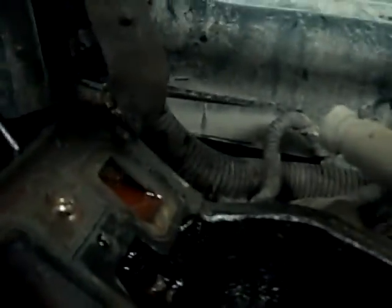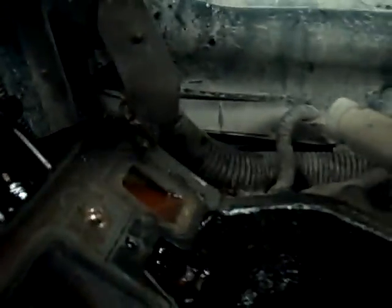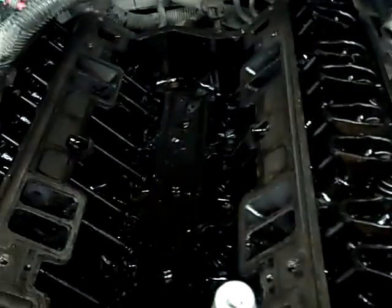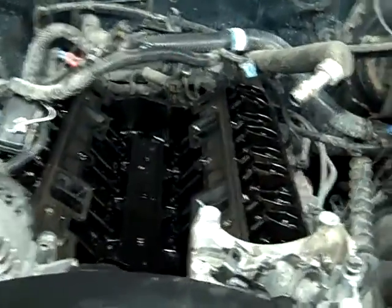So anyway, that's what you do. You can see that there's antifreeze coming out of the backside ones. That one was leaking, and also was leaking out the front. I use a MAC universal pressure kit, and I'll just pressurize from here. That's how I troubleshoot this. You do need to take the valve covers off in order to get the intake manifold off. I tried without, it didn't work. So this is a '98 K1500.